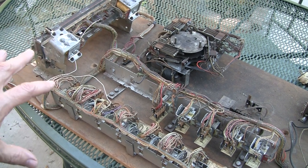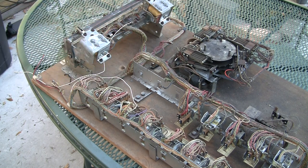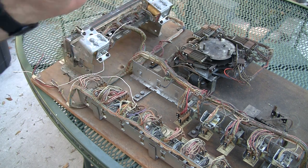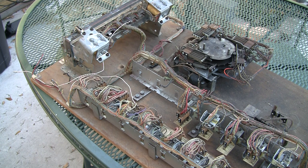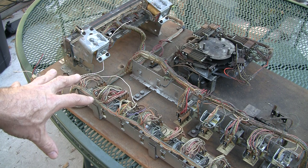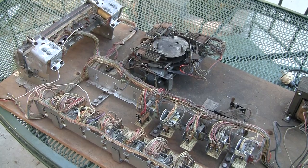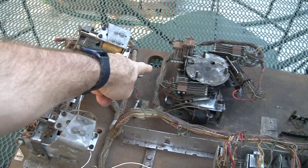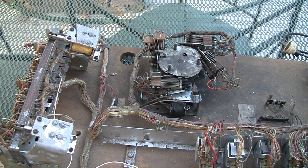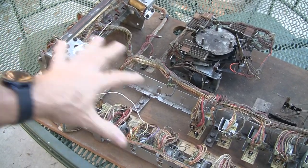Now in this particular game, there are a few things that are missing that are common. There would sometimes be a counter in here — a little analog counter that would have a number on it showing the number of plays or the number of coins that have been put into the machine. Every time you hit start it increments, and it's an analog thing like an odometer in a car so you can get an idea of how much mileage is on the game. There's not one in this particular version, but they're often here. Also there's a slam tilt button that would be right here where this hole is. There would normally be a leaf switch weighted on one side, so if you bang the game and it came undone it would tilt the machine out. But other than that, most of the components are here.